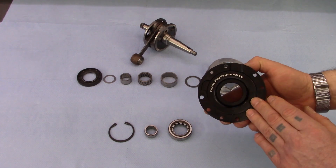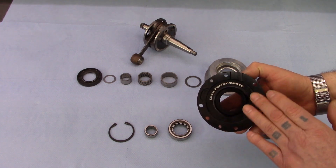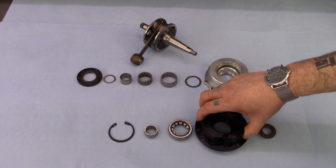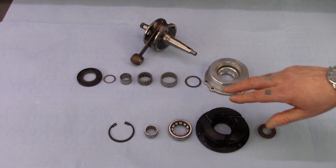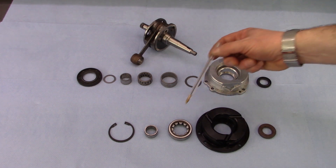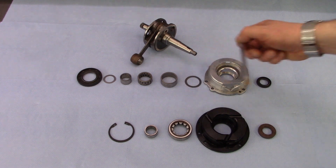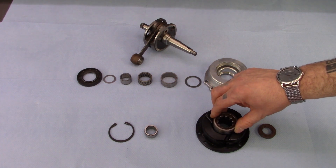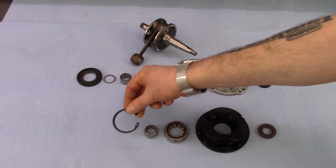This flange has been reinforced in all the key areas — you have no more problems with breakage with the lip coming away. It's a lot bigger than the original, but this is a plug and play replacement part. This flange uses a two-piece bearing; the bearing itself fits down into the flange and is held in place with a large circlip.